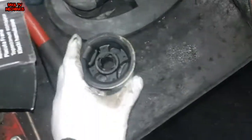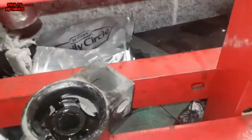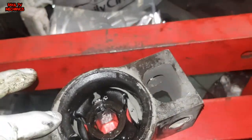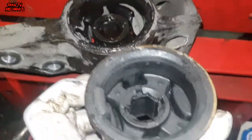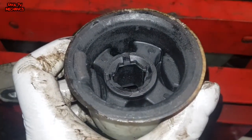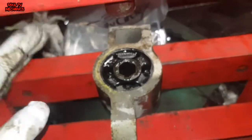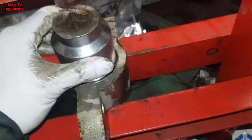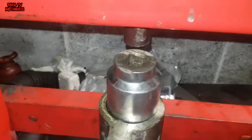On the actual bush itself, the way you're going to fit it — it only comes out one way, so most likely on this one it will come out downwards. On the bush there you can see there's a little raised bit here. Make sure you have that in the right place — sometimes it can be facing down, sometimes this way, whichever way that one is, you put your new bush the same way. So as you can see, that one's facing that way, I'm going to put it that way as well. All you do is put it on there, make sure it's lined up, put the socket on there, and just press that down.